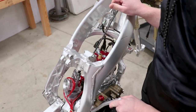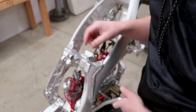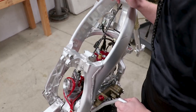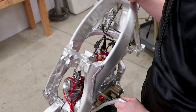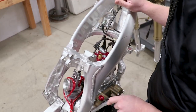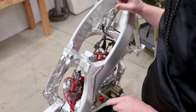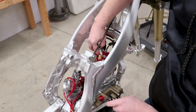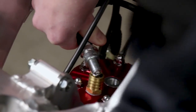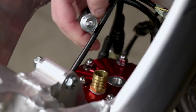What I'm thinking is I must have put too much grease inside a connection, and then once you have a lot of grease in there and you connect the connectors, it must have pushed something apart. That's really the only thing I can think of — everything tested out fine, all the connections were good, the coil was fine, I thought it was the spark plug wire but that was fine too. So the only thing I changed was the grease. Turning the lights out — yeah, that's a nice fat bright spark.